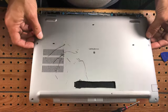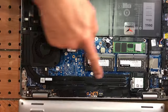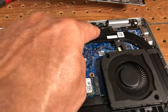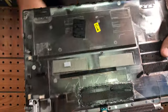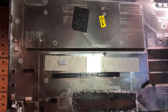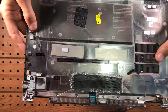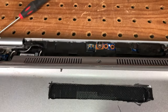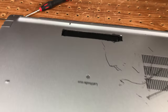Now that we have the bottom panel open, you can already see the heat pipes are super long. The length the heat has to travel before it hits the fin stack and exhaust fan is way too long. This causes the heat pipes to just stifle, in my opinion. While there are vents at the laptop edge, they just are not significant enough for me. So I did this ugly mod to vent a little more of that heat from the pipes. The cut hole in my cover slides right over that hot spot.